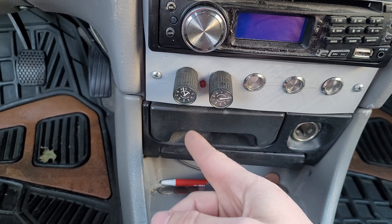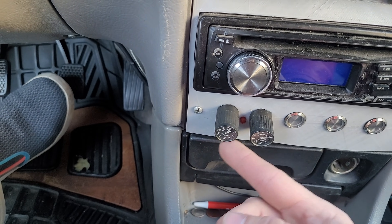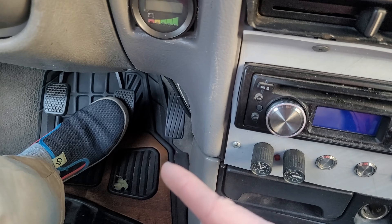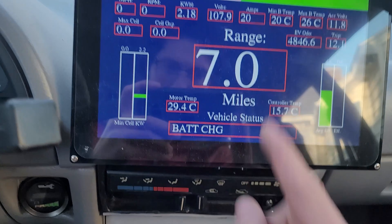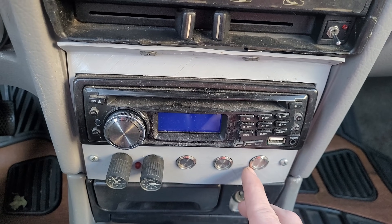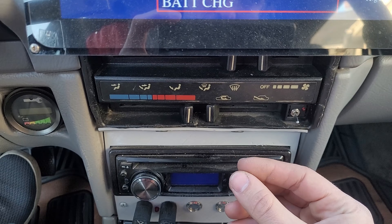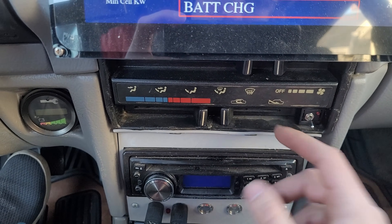This is what I think is the coolest part — the regen knobs, which you can adjust. This is coast regen: when my foot's off the brake it regens by this coast amount, usually set at about 9 or 10. This is the brake regen — as I step on the pedal it gives additional regen. So with brake regen and the normal brakes, this car has much better braking performance than the stock gas version. This button turns the controller on and off, this one turns the screen on and off. This button: pushed in it charges to 100%, pulled out it charges to 80% — on days I'm driving further I push it in. This toggle switch controls a 2 to 3 kilowatt ceramic heating element; if you flip it on you want the fan on full blast so nothing gets melted by the element.